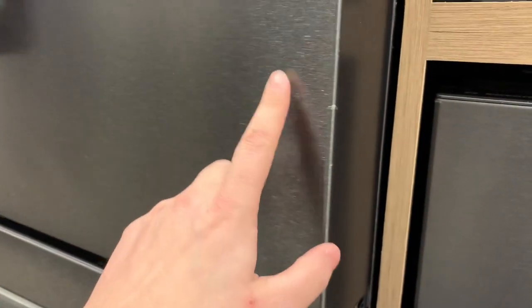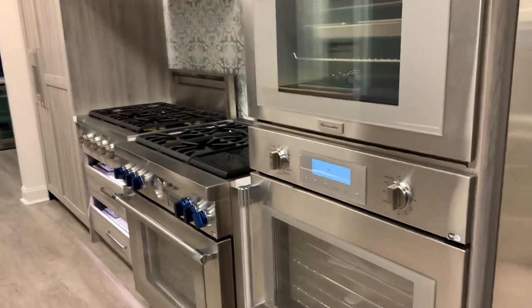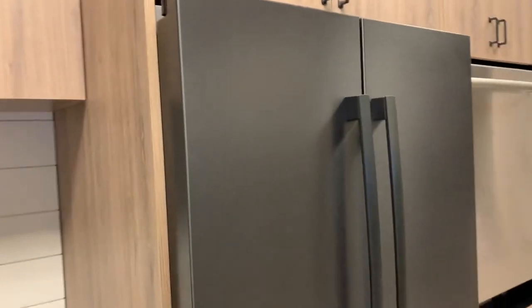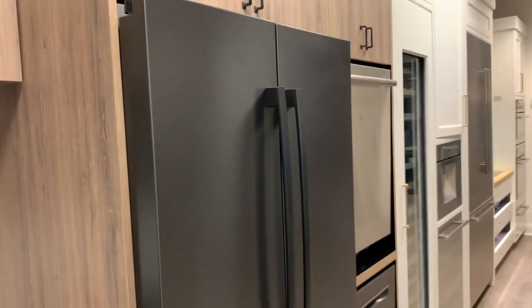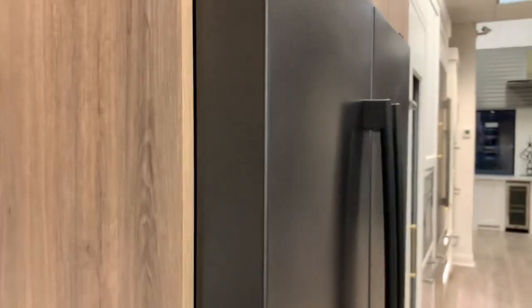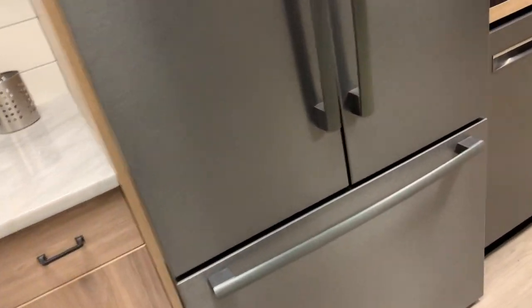This is available — we're showing it in black stainless — but it's also available in traditional stainless steel with a coated finish, and with chunky pro-style handles similar to Bosch's Thermador equipment. So if you're buying a Thermador kitchen and don't want to spend the money on a built-in, you could get a pro-handled Bosch that complements that Thermador package. Remember this is a 72-inch box, not 70, so like KitchenAid or GE Monogram's counter-depth refrigerators, this one is a little bit taller. The hinges do seem to cause this door to bind quite easily, so be careful about placement — there's not a lot of clearance, and that door will hit your counters if you're not careful. Make sure your kitchen designer pays close attention to the clearances and specifications.